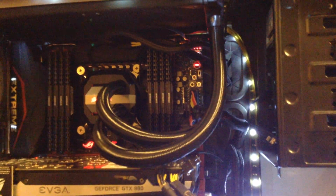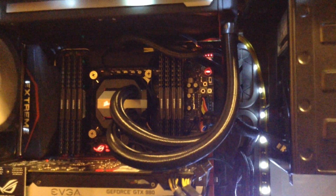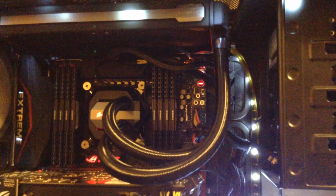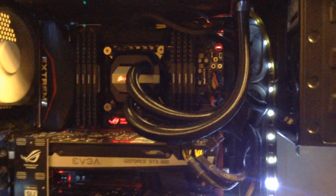You want to leave everything in your BIOS as you get it. Change your RAM to the XMP. Change your CPU voltage. If you want to overclock the Uncore, change that to what you need. Up that voltage, up the system agent voltage, and up your fans, and make sure you're booting off of the right drive so you can get into your operating system, and that's it. All that other fancy stuff, you just leave it as is, and that's what I did. So that's where we're at.